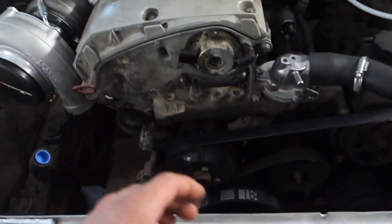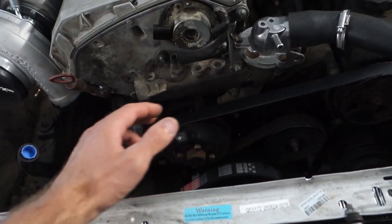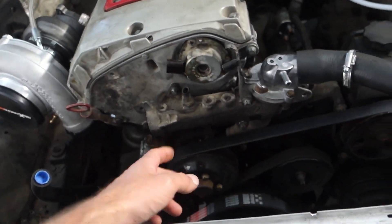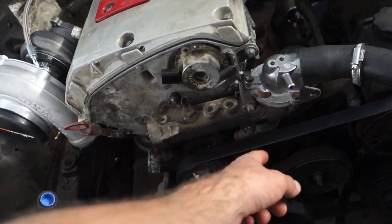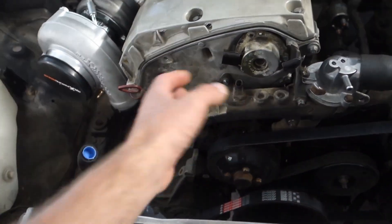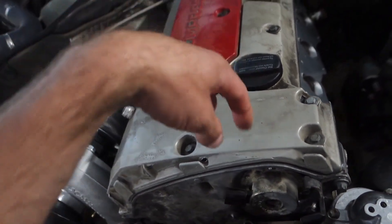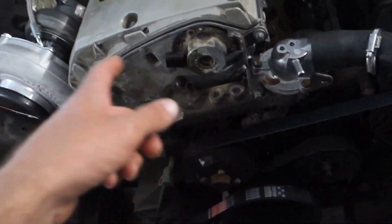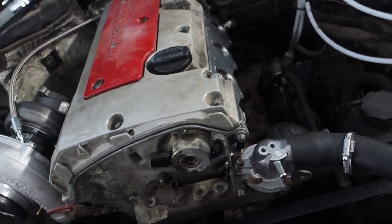Also, when fitting chains during a complete disassembly of the whole timing set, I recommend locking both camshafts with two pins, setting the crankshaft to 20 degrees, then laying the timing chain around and putting the sprockets in place — VANOS and exhaust. Also check that the VANOS and camshaft position is retarded. Then check timing as I showed before. If you do that precisely, you'll get everything spot on.